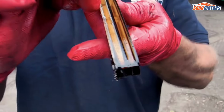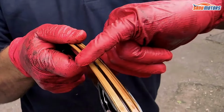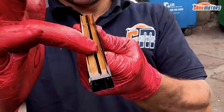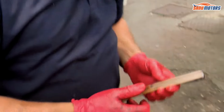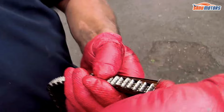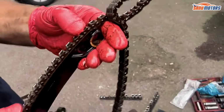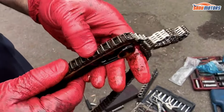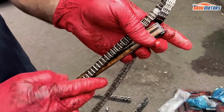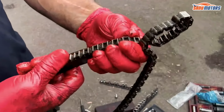You've got a little groove there, like in bowling lanes, where you can put the boards up. So the same thing up here, you've got little boards, and the chain has to go in between. It's easy to put the chain on and it will sit like that. When you pop that in you think, oh, that's in, but it's not. You need to go until the chain actually sits in between them two grooves, because if you don't, the timing can pop off or move. So not like that, it has to be there.